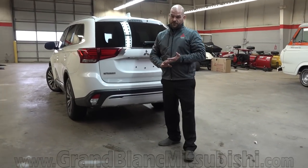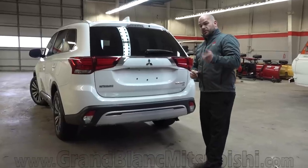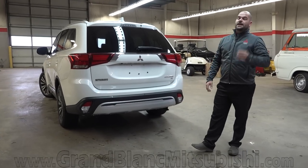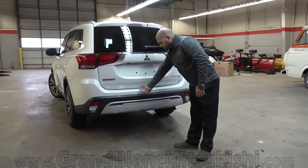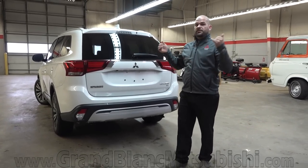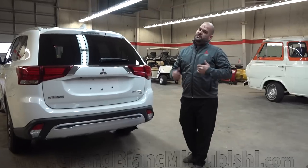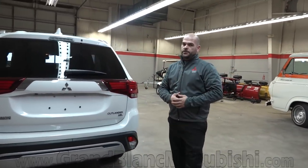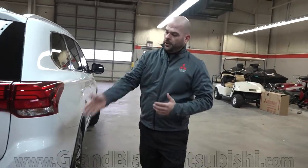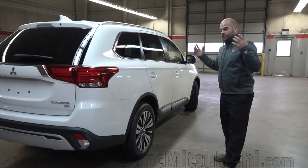This vehicle is available with a trailer towing package — 1,500 pounds on the four-cylinder 2.4 liter, or 3,500 pounds on the GT with the trailer towing package. Can you add a trailer towing package if the vehicle doesn't have it? Absolutely. The service department removes the rear bumper cover, takes off the aluminum bumper and replaces it with steel — that's OEM Mitsubishi parts. Mitsubishi stands by that, including the warranty and the wiring harness. Your five-year, 60,000-mile full comprehensive warranty will include that trailer towing package and wiring harness.